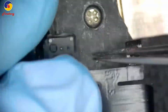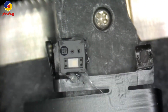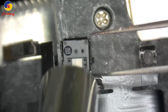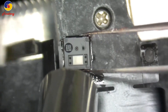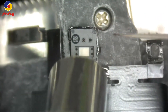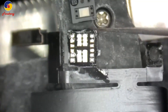Now let's take off the proximity sensor and flood illuminator module. This is the original one — let's remove it. I will swap it to the good cable. Blow it — put some flux and then blow it. I'm using a very ordinary holder; you can use any holder. But it's better not to use a steel or metal holder. Take it off.